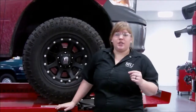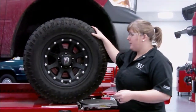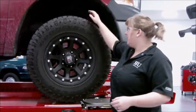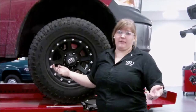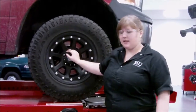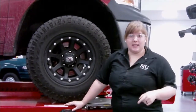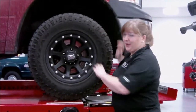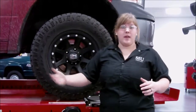The next thing you want to do is jack up the vehicle. If you think your problem is in the front, go ahead and jack it up. Give the wheels a spin — put it in park, or if it's a front-wheel-drive vehicle, put it in neutral. You should be able to spin the wheel with a finger or two with no drag from the assembly. Then get someone in the driver's seat to press on the brakes. When they press on the brakes, the wheel should not spin at all — even with all your might. If you have even a little movement, your piston could be seized and not extending all the way, and you've got a problem.